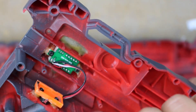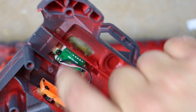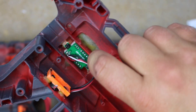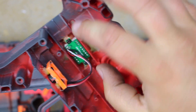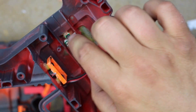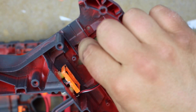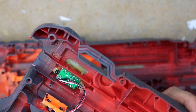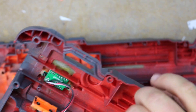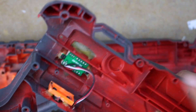I just cut the stem down a little ways, screwed it onto the board itself, added a little bit of DevCon to tack it in place, set it in, located it, and held it in place for a little bit. Once that cured, I was able to back out the screws, take the voltmeter out, reinforce where the screw bosses are mounted, and dress it up a little bit. Now I have solid mounts for the voltmeter.